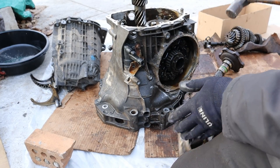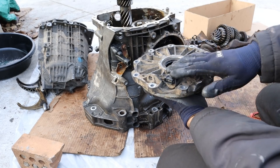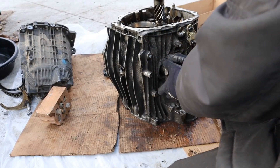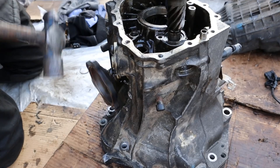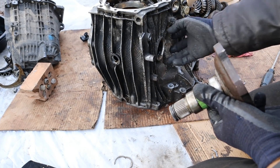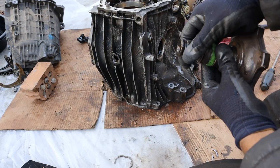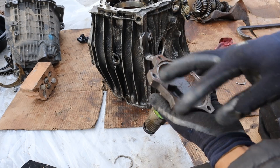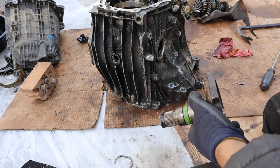Releasing the circlip from the other side, I was able to knock the input shaft loose. After a lot of prying I got that axle flange out — you're really fighting this C-clip as it sticks into the front differential. Knocking off this side piece, inside you have your speed sensor which reads the final drive speed through this ring. Over on the driver's side I've got the other axle flange. If your transmission is leaking there is a seal inside here supposed to seal the transmission fluid against this flange — interesting design because other automakers just make this entire flange part of the inner CV shaft, but instead they've added a bolt-on feature to make it easy to pop off the axles quickly when you need to swap the engine and transmission.